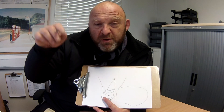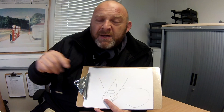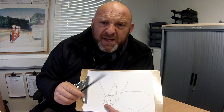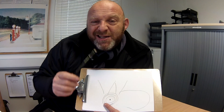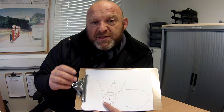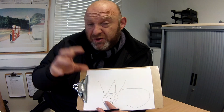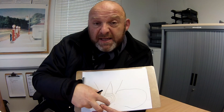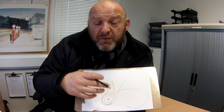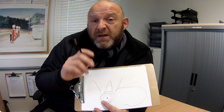Voltage created, no voltage. Positive, negative. Positive, negative. And you can see where my mind is going because all of a sudden you get this kind of sine wave going along, and this is what the alternating current is. Now this current — or voltage in voltage terms — can drive AC consumers directly. But what happens is that this generated power has to be controlled and it has to be sent to the battery, to charge the battery and also to power the rest of the components on the motorcycle. The alternator is now producing alternating current or AC voltage, which is then sent to the voltage regulator and the rectifier.